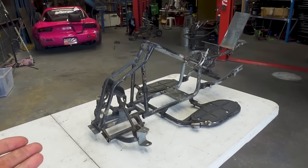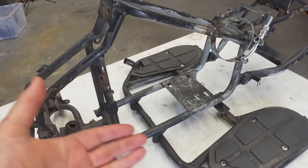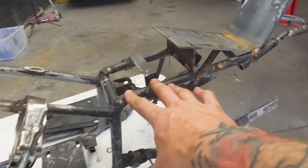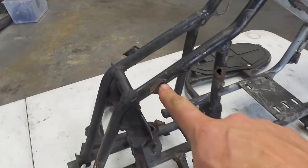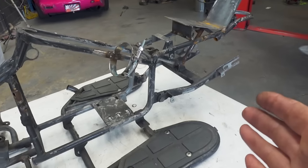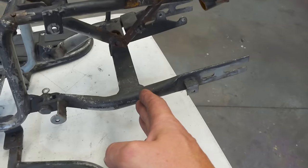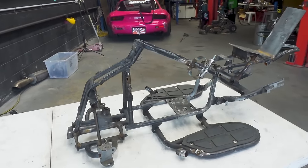She's a bare naked shell. These things are so fun to work on simply because you can do so much in such a short period of time. That literally took me 20 minutes to completely strip the whole thing, and now you get a better idea of how janky this setup is and how much we can improve. I'm going to start by chopping out everything we don't want and cleaning up all the random crap. We're also going to extend the wheelbase - it's a little too short which makes it snappy when we drift. We'll shift the engine back and extend the frame by about 50mm, which on such a small car is going to make a pretty big difference.